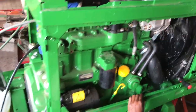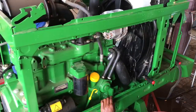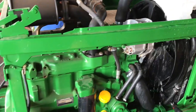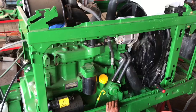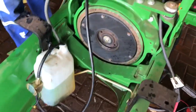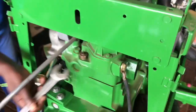We're going to start the engine in its chassis for the first time. I'm just flushing the cooling system so we know there's no rusty water or rust in there, then we'll add coolant. Side note: basically this is like a heart transplant — that's why it's looking like she's hooked up to a life support machine.